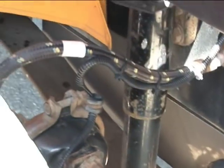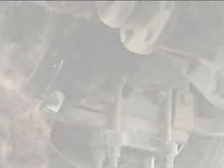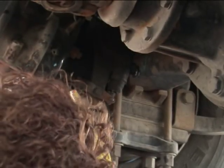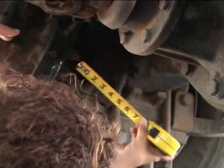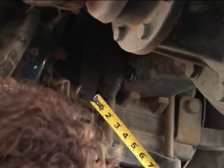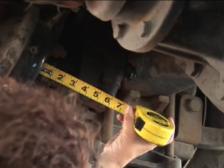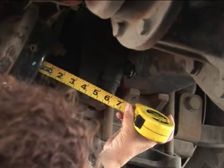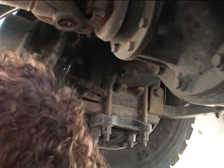So you're going to take your first number, which was 3 1/8, and minus 4 1/4, which gives you 1 1/8 for our front. Now for the back, you can see how our push rod has come out. Put it against the chamber again to the end of this clevis pin — that is 4 1/2. So 4 1/2 minus 3 1/8 gives you 1 3/8.